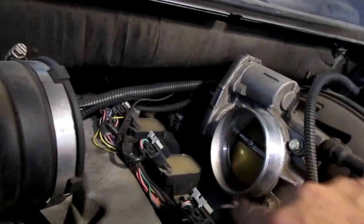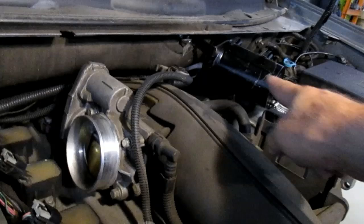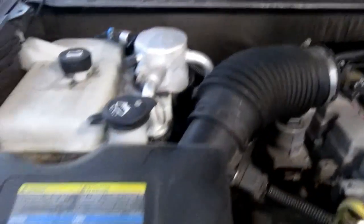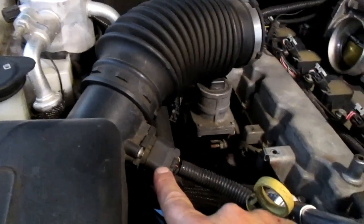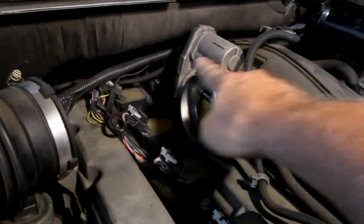When you give it gas, you're changing the amount of air being drawn in. You want to get the HHO — here's our hydrogen filter — as close to the throttle plate as possible. Don't put it into your air filter because you can mess up your readings on your MAF sensor and defeat the whole purpose. On this one there's an IAT as well, so five wires total.